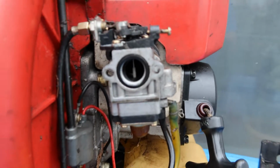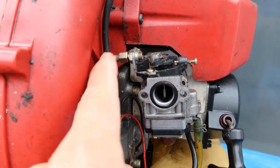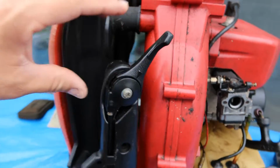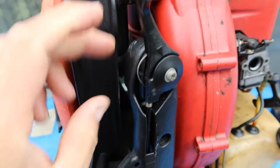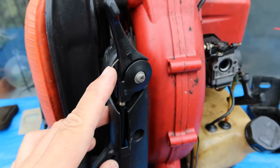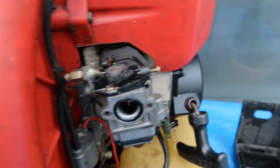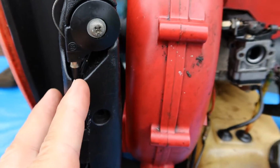As I had just said before, it's a barrel style carburetor, and when I follow this cable line here, it comes up to here. Now with my WD-40, I went and sprayed everything like I said. This can now turn, but you see how it's spooling up right here? That means nothing is changing here. So when I turn this, when I go up and down, that thing is supposed to come open and closed, and it's not. So what that tells me is this line is seized.